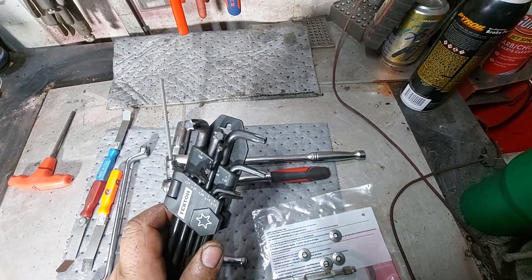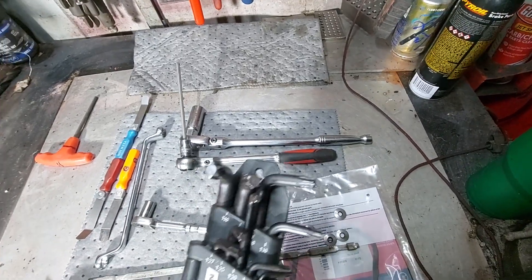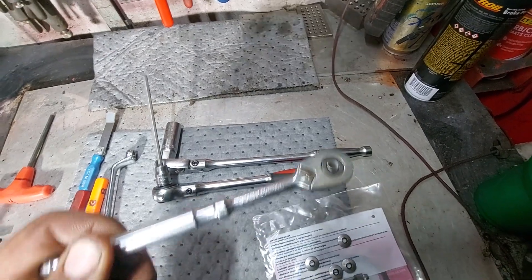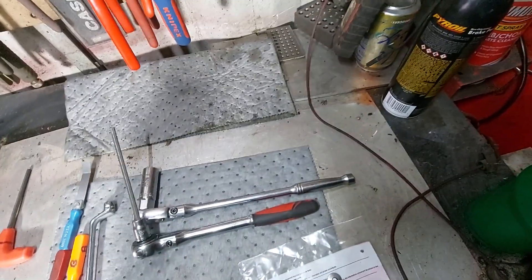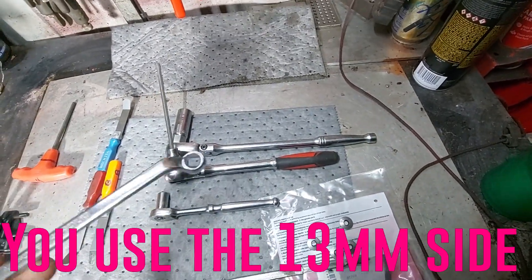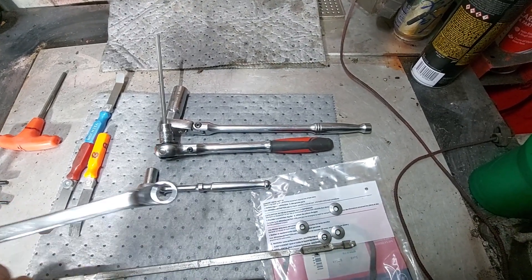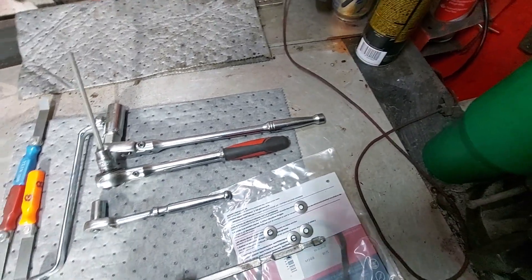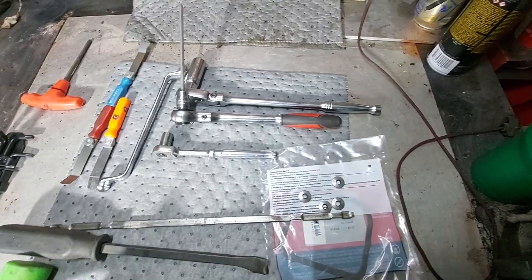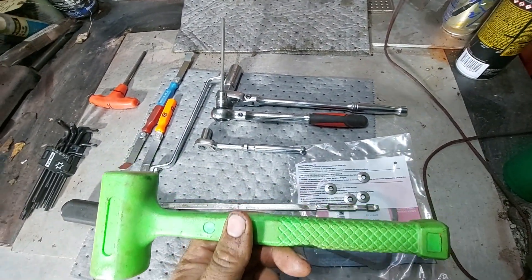Some Briggs and Strattons and other engines you might need a Torx, so just know ahead of time that you've got the right tools. Most of the time it's a 10 millimeter to pull the valve covers off. These 12 millimeter offset wrenches work real good for adjusting the valves - you don't need a super good brand, there's just not a lot of torque applied. Sometimes you need a pry bar to get underneath the valve covers, other times they pop right off or you can give them a light whack with a hammer or a piece of wood.